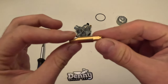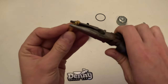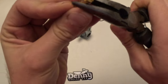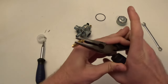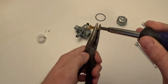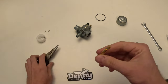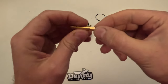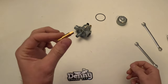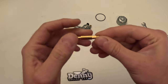Now we're going to show you how to change the main jet. This came out as all one piece, but all you have to do is take a pair of pliers to hold the atomizer and then take a flathead screwdriver to unscrew the main jet out of there. As you can see it comes out pretty easily — it just unscrews right out. That part in our hand is called the atomizer, and the little part is called the main jet.